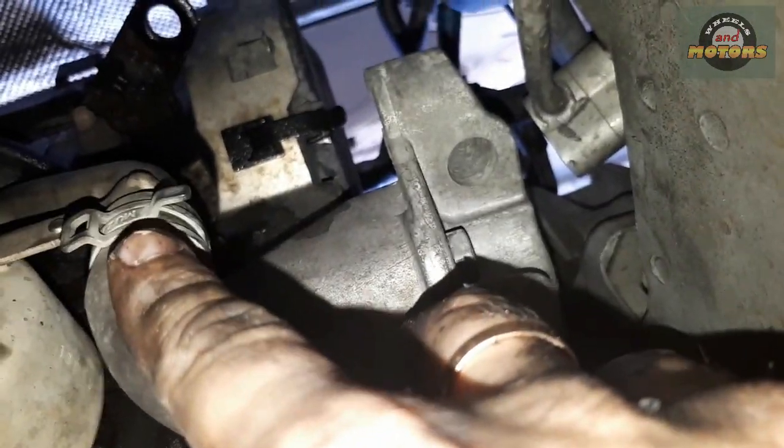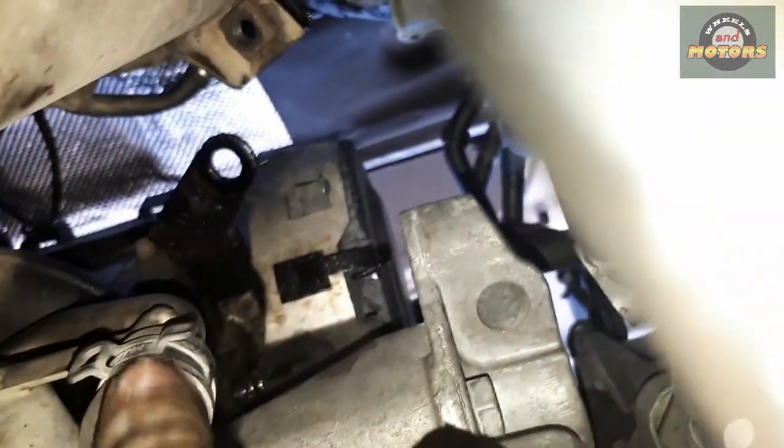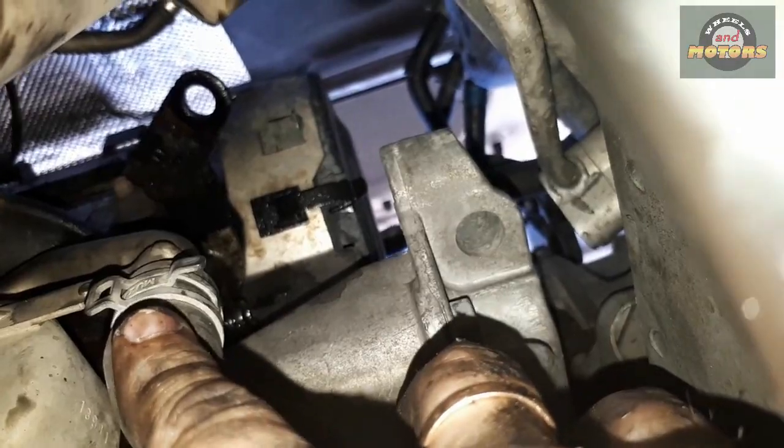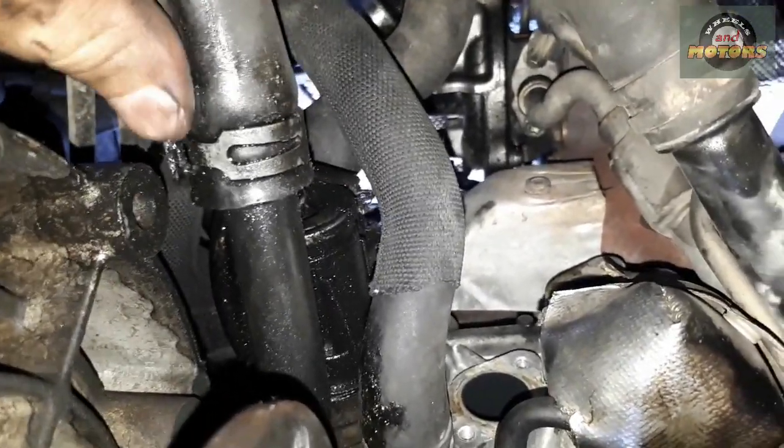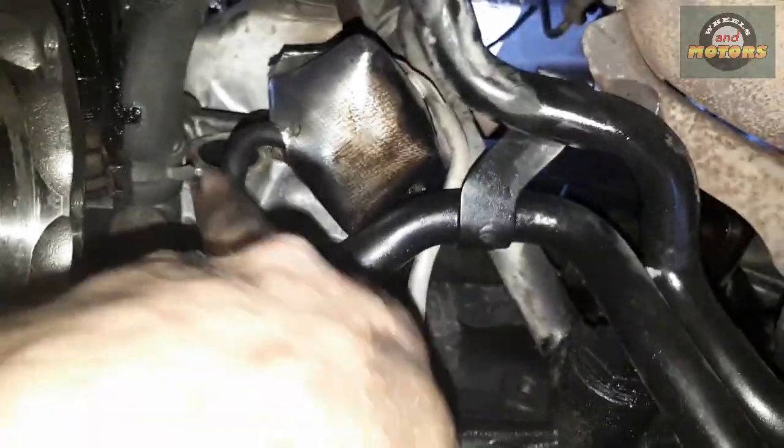What I'm going to do is drain the coolant because it's always nice to refresh it. There's another pipe — that's the one on this end, and then that's the other one — another clamp, and then there's a metal pipe that is part of the EGR. So we disconnect here and here and drain the coolant. I'll put the tray underneath. Before I drain it I'll reconnect the oil sensor so it doesn't get filled up with coolant. I've put some rubber glove here as protection. With all that disconnected it didn't leak that much coolant — just a little bit — so we're safe. We'll top it up later.